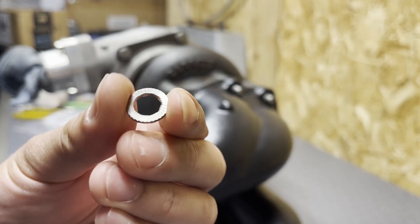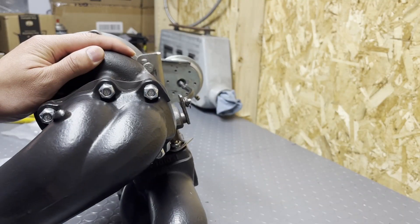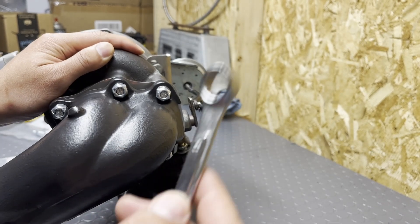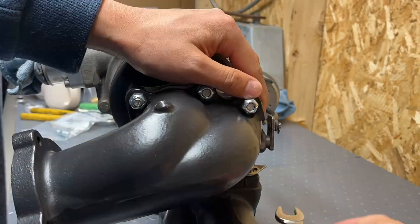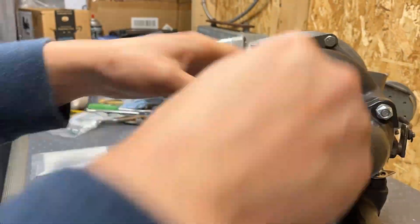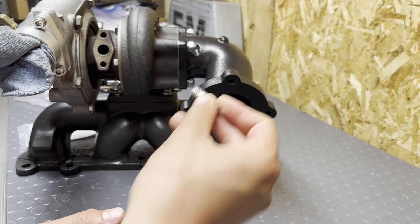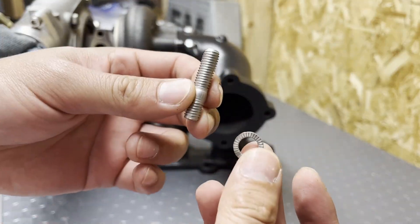For the hardware I'm going to be running these NordLock washers — they should keep the nuts from backing off once installed. There's no way to really fit a socket around most of these except for two of them, so you're just going to have to tighten it down by hand using a wrench. It's a 13 millimeter and we're going for about 16 foot-pounds. Now we're going to get the studs into the downpipe — these are the same studs used for the turbo outlet and the same nuts and washers.